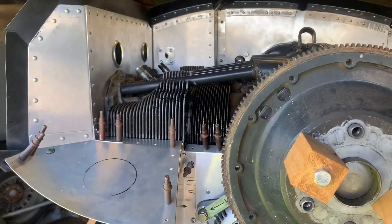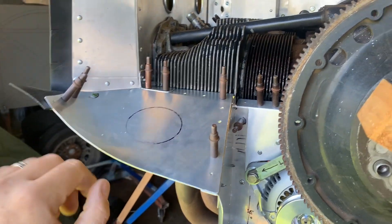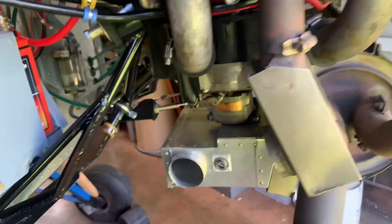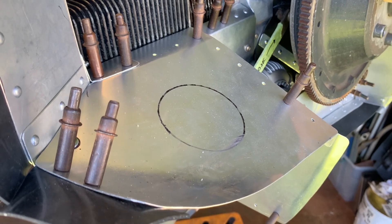As part of the air cooling is the oil cooler, so I need to cut a hole here and duct to an air cooler. And on the other side here, which I've got off already, is going to be part of your carb heat, which will eventually go down into here. I've got to create a hole for the ducting.